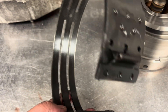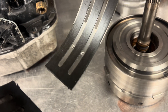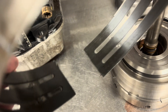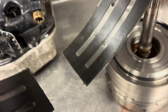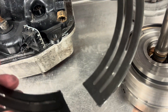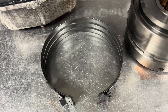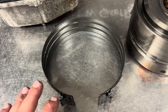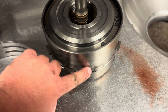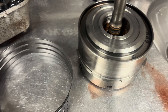Let's take a look at the second gear band. Overall, this actually looks to be in pretty good shape — you can still see the green of the lining on it; it's not overly black in any areas. You can definitely see the three areas where it was applying and the color difference there. Because it is a few years old, we're going to go ahead and put a new one in it. These bands are cheap, so I'd feel a lot more comfortable sticking a new band in it. The drum feels good and just needs a fresh resurface for the fresh band.